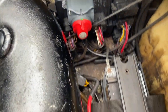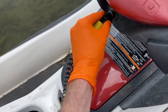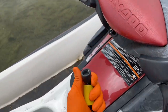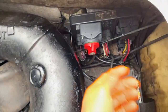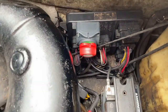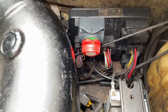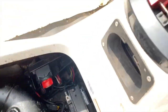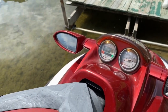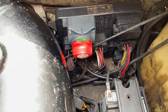The switch is in the off position because the battery icon is on its side. I grab our jet ski key and try to start it — absolutely nothing, no gauges work, no sounds whatsoever. I pull the key off, go back down into the hull, and turn the switch on by shifting it clockwise. The mold of the button is now in position with the green 'on' portion, the battery icon is upright, and that switch is now providing power to the battery.